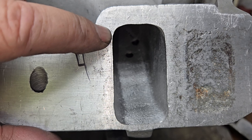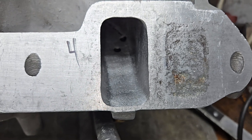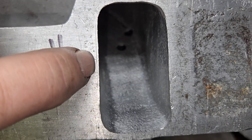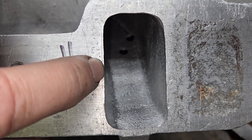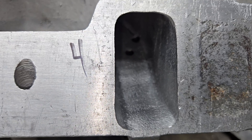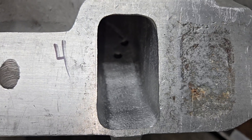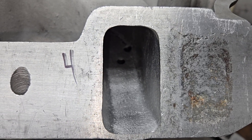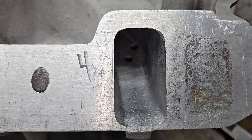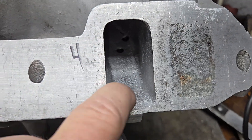We had to do some work on the head and a ton of work on the intake, because once you increase this height to make it match - and in reality this is a tiny bit smaller - the manifold is a tiny amount smaller than the head all around. I want it that way. This isn't 100% perfectly flat and square, which is that final finesse stuff that drives me crazy. If you increase this, that ruins your taper into the whole manifold.